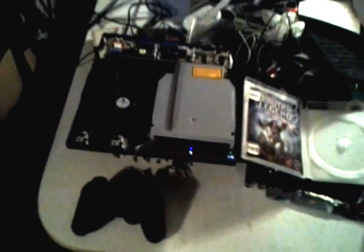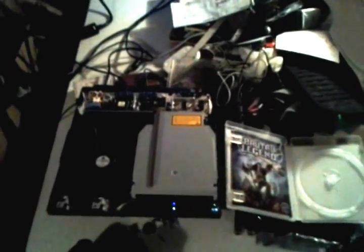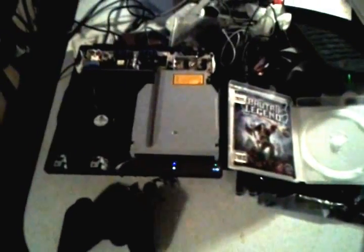Just so you have proof of work — I couldn't find any fixes for it, not at all, aside from replacing parts. What I'm going to do is take some 120mm case fans and drop one right here above the bare power supply, with a little bit of netting as a dust catch, to keep that thing breathing nicely. Hopefully this thing will see a couple years of good use. I really hope this helps somebody. If anybody's got any other fixes for this same issue — the immediate power-down when you try to turn it on — let me know and let other people know, because as far as I know this is the only fix out there for a bad power supply.